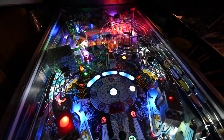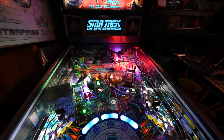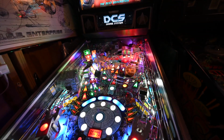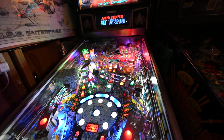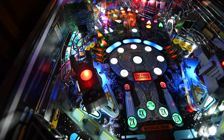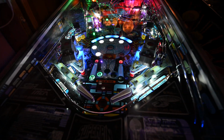Of course, it's got a bunch of optos throughout the subway system to help the game code understand where the balls are and help tally them. So essential maintenance is to clean the optos and keep them maintained, then also to periodically clean and maintain the cannons. And that's something I am pretty diligent about, but not everybody is, so whatever.